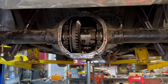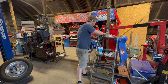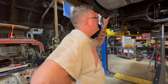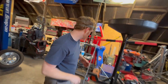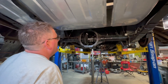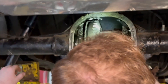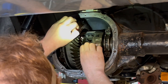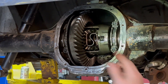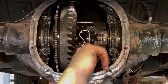Take the pin out. Pull the pin out and push the axle in, then take the brakes off so you're able to push the axles in. You can start to see the C-clip as you get around to the side.